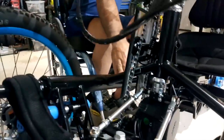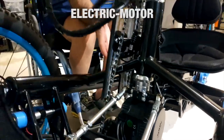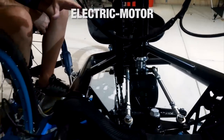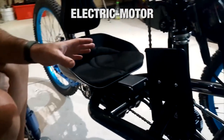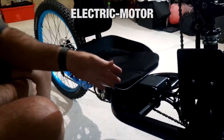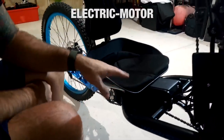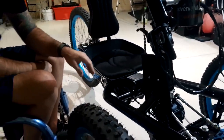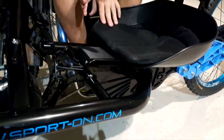You can see down here the electric motor is a standard Bafang mountain bike motor, which you can put onto any bike. The motor is actually a 750 watt motor. These motors are all programmable and the output does rely on your gears, your ratio, and your battery voltage as well. You can get a few different battery voltages and these motors work with a lot of them. It was quite simple to put together.